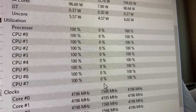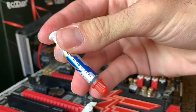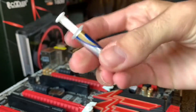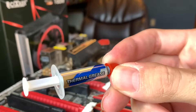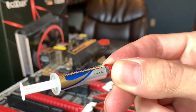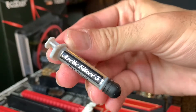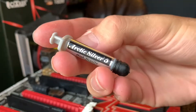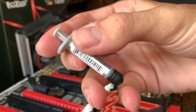This isn't a comparison video, but for some context: using the same motherboard and CPU with a Cooler Master Hyper 212 EVO, I was able to hit 4.5 GHz at 70 degrees C. Also, the included thermal paste is extremely cheap, and I'd highly recommend switching it out. I used Arctic Silver 5 — it's pretty cheap on Amazon — and noticed a 10 degree drop immediately after switching.